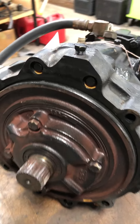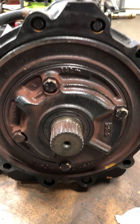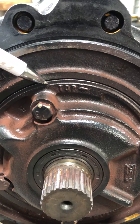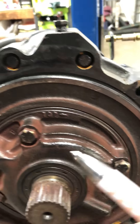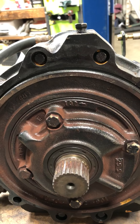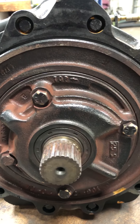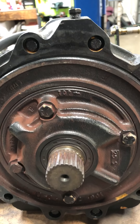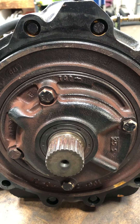There's always controversy and questions about the pump. This is the front pump. You can see here at the top it says 'top' right on the pump. This is the brake line here. It says 'top' and it's got an arrow pointing this direction — that means this pump is indexed for right-hand rotation. We're looking at the transmission, so you've got to look at it from the other way, but the flywheel is turning that direction. Marine rotation is always viewed from the flywheel end.